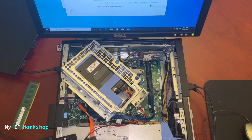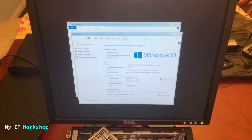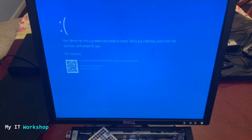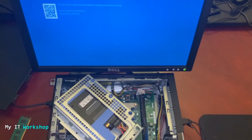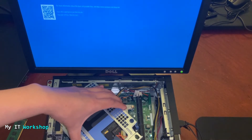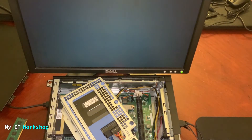I disconnected it, and now things are shifting around — the RAM fell and so on. Going back to the monitor: I can still move the mouse, but the background went dark. I can still move the mouse but cannot click on anything, and it's slowing down and then it's stuck. Right away we see the error: 'Your device has run into a problem and needs to restart.' It's collecting some data. I tried to reconnect it but I was too slow — the computer already rebooted itself.